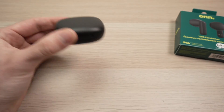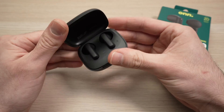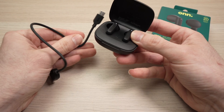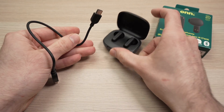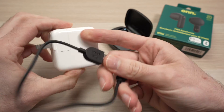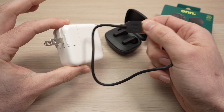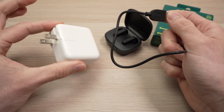Once that's done, pair them once again. Another thing you can check is that they are actually fully charged. Sometimes you plug in the cable they came with and think they're charging, but they're not. This may be because the cable is no longer good — these are cheaply made — or maybe the charger you're using isn't great. Sometimes if the charger is too powerful, it will have trouble charging these earbuds that don't require that much power.